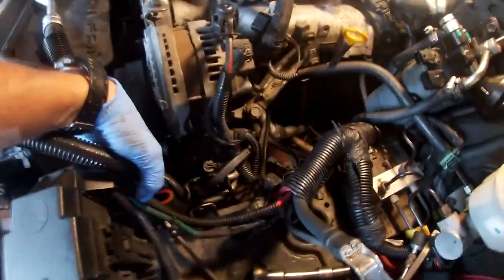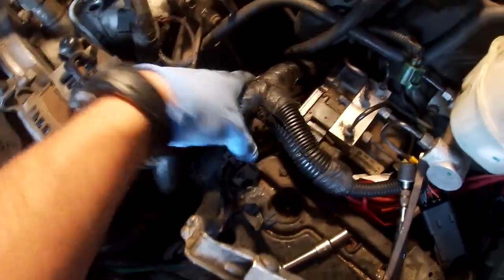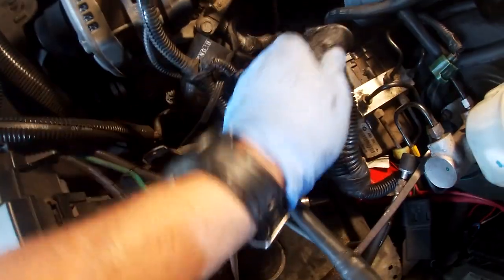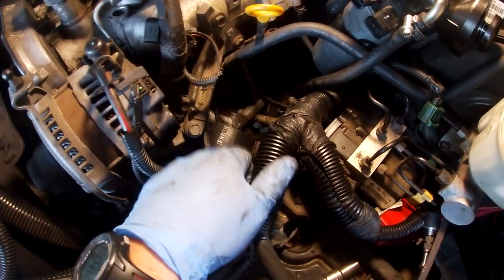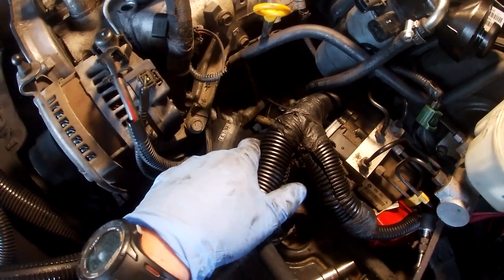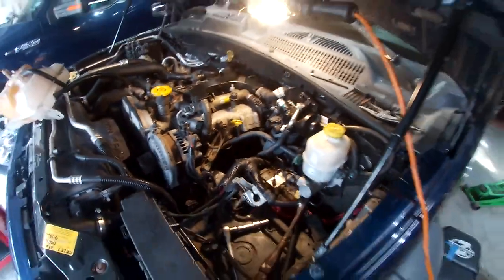What I did was take the tube to the intercooler, pulled it back, tucked it back here, grabbed a bunch of these wires, picked this wiring harness up and over — and that gave just enough room to squeeze through. Because I was already starting to think about disassembling it and pulling it out piece by piece, but that would have been miserable. I got it out.